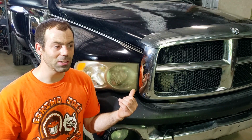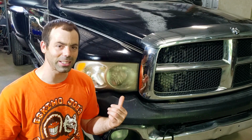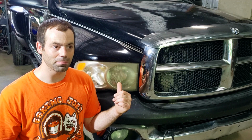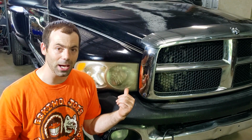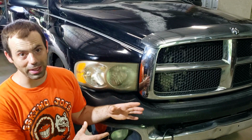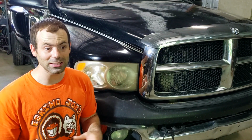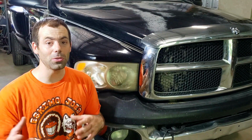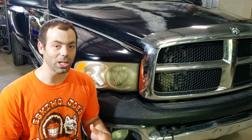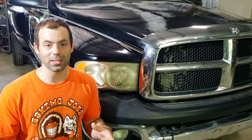And then we realized, you know what, might keep it really saleable for the guys that wouldn't understand why a 12 valve swap is so incredible. But to make it easy for somebody to pick up, we decided to go ahead and take the black hole and pick up a 6.7, and we're going to be doing a 6.7 transplant, not a 6.7 head, not a 6.7 crank. We're going to be doing a whole 6.7 transplant into the black hole with the correct injectors and making sure that everything's right.